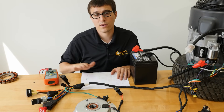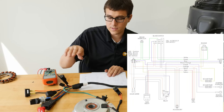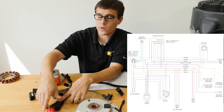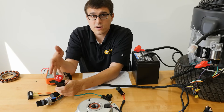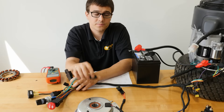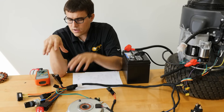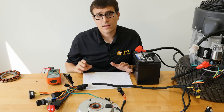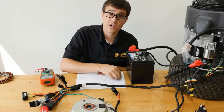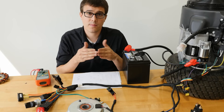When your key is on, you should have positive 12-volt power at all your orange terminals. We also have a green circuit, which is for start. When we turn the key on, it energizes the green wire which goes to the blade switch — if the blade switch is on, it won't let us start the engine. Then it goes through the brake switch, so you have to have the brake on to start the engine. The real principle is that a lot of these wires daisy-chain through the system and you have to follow the schematic, tracing power from the battery or component you're working on — both the ground side and the positive side — up to where you think you may have a problem.